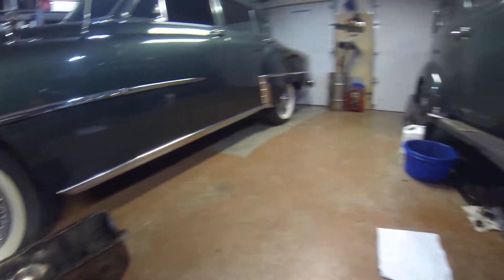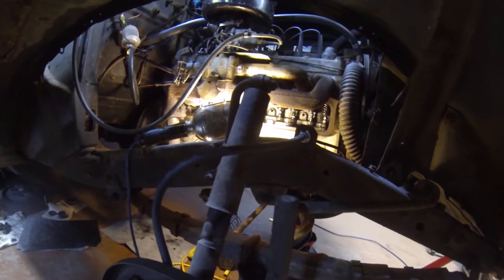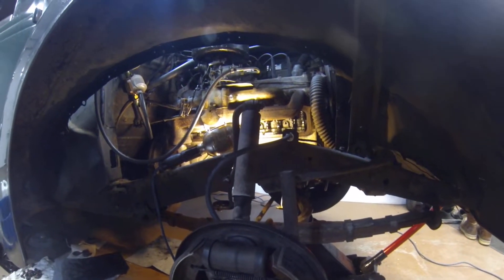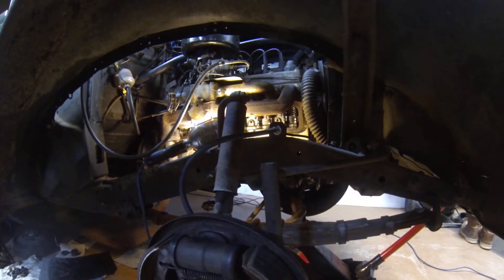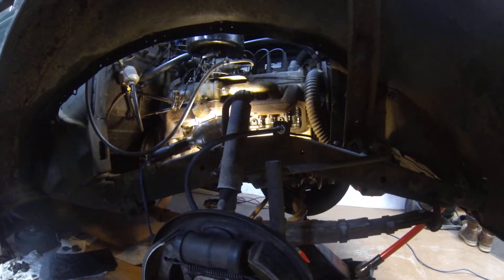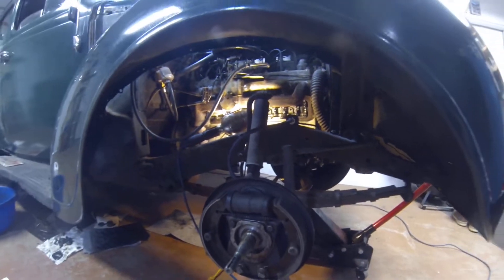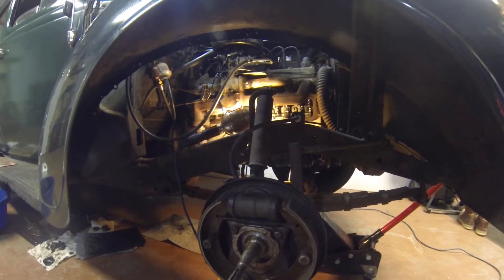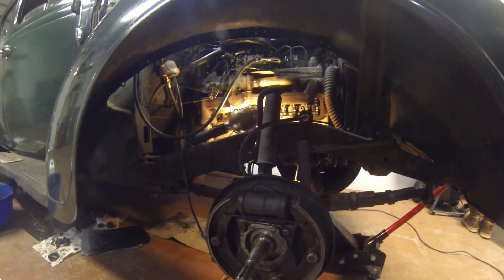So I'm going to get the sludge out of the oil pan, out of the galleries and these pools, and inside the crankcase around the valves using solvent. With the oil pan off, because I don't really know the history of this engine — it's from 1954 — it doesn't seem that tired to me. It makes good compression, good vacuum, and there's not a lot of sludge, which are good signs. So I'm going to pop off a bearing cap, look at one of the connecting rod bearings, and check for any scrapes, scratches, signs of dirt, or damage from improper warm-up that could starve a bearing.